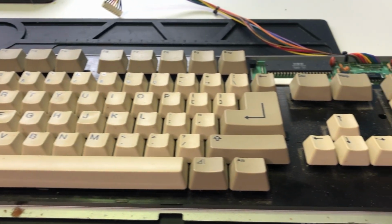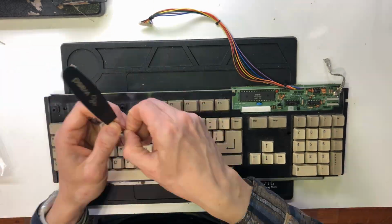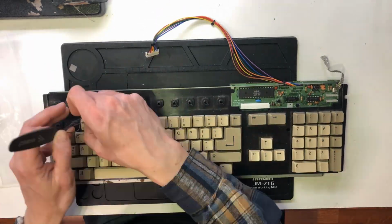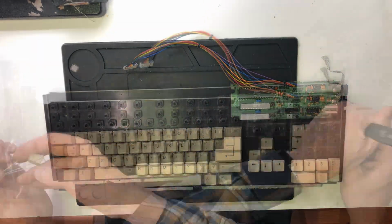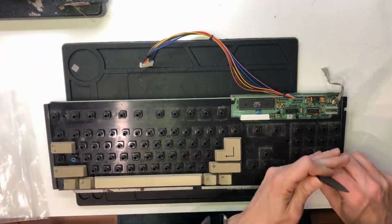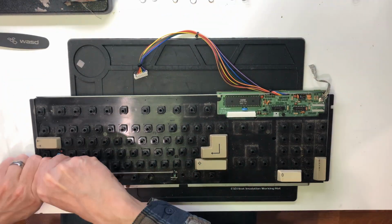While I realize that retro-brighting is a bleaching process and cannot prevent the underlying photooxidation of the ABS plastics that causes the yellowing, I felt that I could do a mild treatment and enjoy the results for as long as they lasted, if only to see the Amiga in like-new condition for a few years.